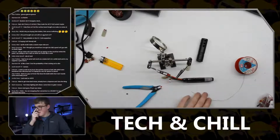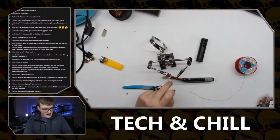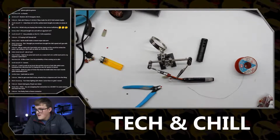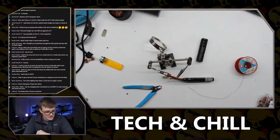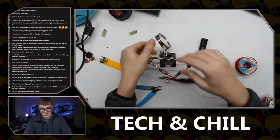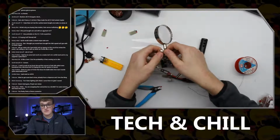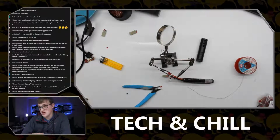Yes, these are Deans. These are what are called mini Tamiya. These are Deans, or you'll hear them referred to as T plugs. They're more robust than Tamiya. They can carry a higher current, and they're just generally a better connector. There is an initiative called the T plug initiative, which is trying to get everyone to switch from mini Tamiya to Deans, but I doubt that's going to happen anytime soon. But a nice little start. One of the things I did appreciate about the Evo is it's Deans as standard, which is good to see.